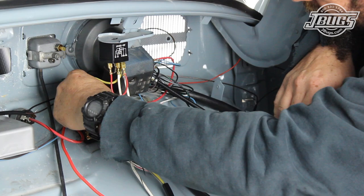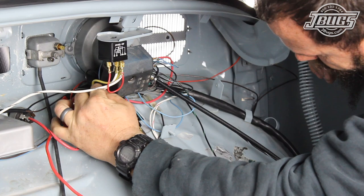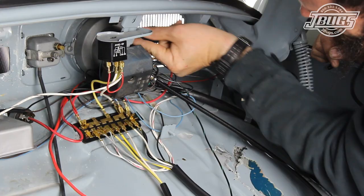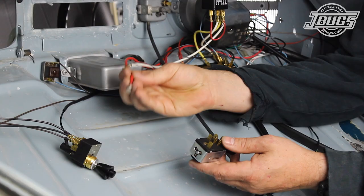Next, the yellow wire is connected to the middle terminal at the top of the fuse box. The white wire from the relay is plugged into the second terminal from the right at the top of the fuse box. Original fuse boxes have a secondary terminal for the high beam indicator bulb, but aftermarket fuse boxes do not. So we add a piggyback terminal at the white wire terminal connector on the fuse box and plug the loose blue-white wire to the terminal there. The other end of the wire is plugged into the high beam indicator bulb on the back of the speedometer.